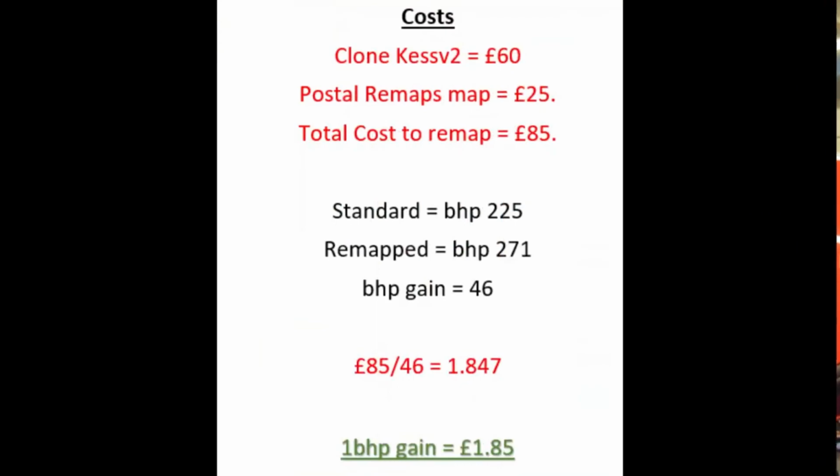I'll see you later. Okay, let's have a look at the cost now. So it's cost me £60 for the clone Kess V2. The map from Postal Remaps was £25, which comes to an estimated cost of £85. Now, the car had a standard ECU map on it, so that made it 225 brake horsepower. The remap, and on the dyno run, you could see that yourselves from the video, is 271 brake horsepower, which means a massive gain of 46 brake horsepower, which I think was fantastic.